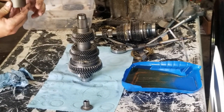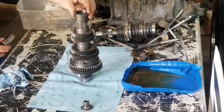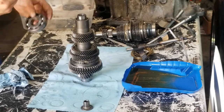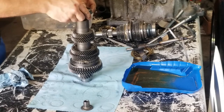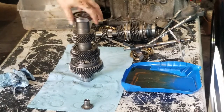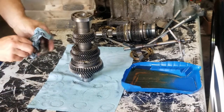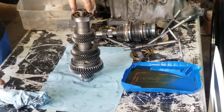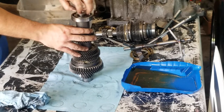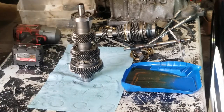Be careful if you're hitting on this because it can mushroom it out — try to get a socket that fits on there just perfect but will also fit over the shaft. It's got some little shims — those go towards the spacer. Tap that down on there. Then we have our nut that goes on here, and to tighten this one I'm going to turn it counterclockwise to the left. Then I need to get my Allen — that is a 12mm — to tighten this down.